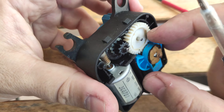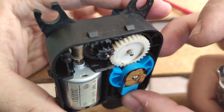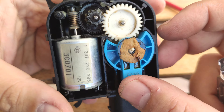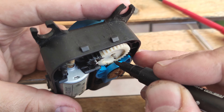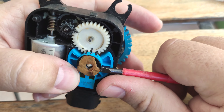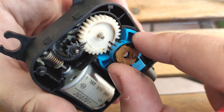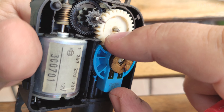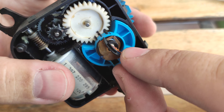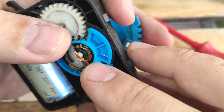I put this brown material because I broke those plastic pieces and didn't have any replacement parts. Some kind of glue I put there. It's pointless to try to remove this potentiometer from there and you don't need to. All you need to do is on the right side — that's where you're supposed to open it. It's always a good idea to make markings on the gears so you know where they're supposed to be. The plastic dust cover was made to be able to open, but if you break it you can put a bit of glue on top and it still keeps the dust cover in place.